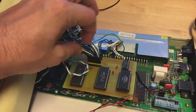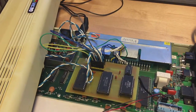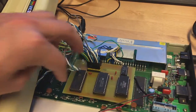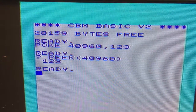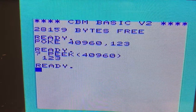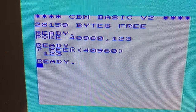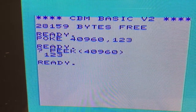Currently everything is selected — the first three select the first three kilobyte extension, and then we have the different blocks. Looking at the screen, you can see I now have the maximum amount of BASIC memory free. Using POKE I can write to block five and it reads back correctly, which means the 8 kilobyte area reserved for cartridges is also working.